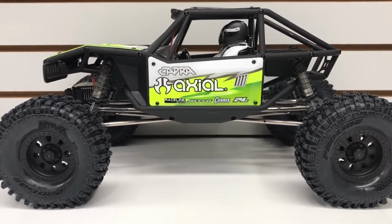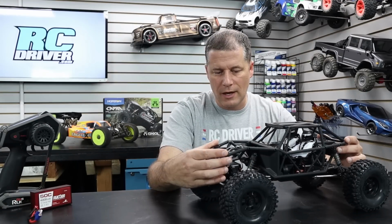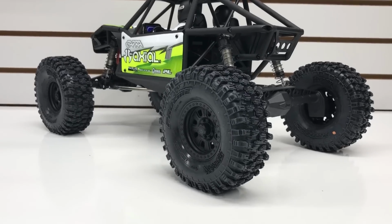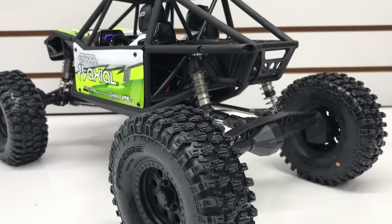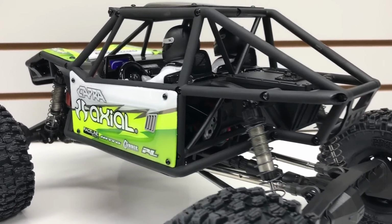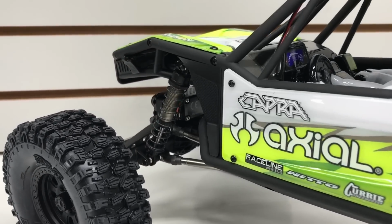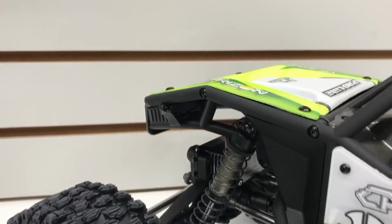So there's people seeking out optional springs to let the rig have a little bit more droop in it. Some people are also putting pen springs on the inside of the shock to push against the piston and help lower the vehicle a little bit. So that's a little bit of a gripe there as well. I wish it had some more droop. A lot of people wish that, just to get some better handling out of it.